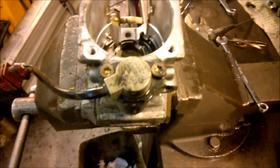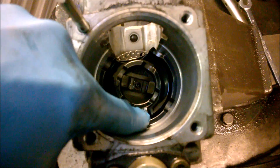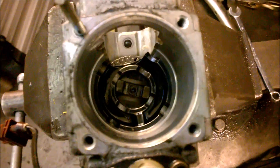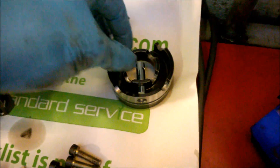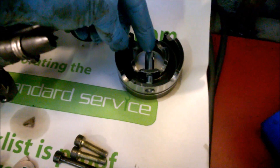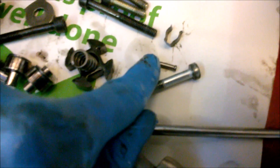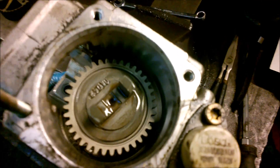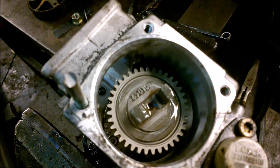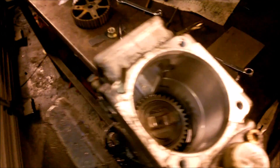For my application I don't actually need this advancement because I'm swapping it out to a different pump — semi-advanced, basically. There's a clip there that needs flicking up and a pin in the centre. Then that pin comes up and you can lift out the roller assembly. That pin slides into the advanced mechanism on the bottom — it goes through there like that. See that little hole? This little pin slides in and clips over the top of that. You've got your shaft and your pump; make sure everything's off and it should quite happily pop up.